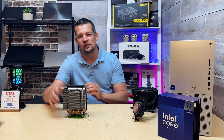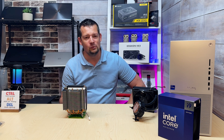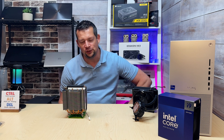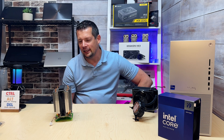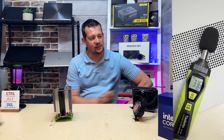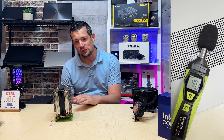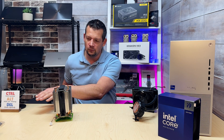When the tower cooler is installed and idling, I can hear a little bit of fan noise, but it's almost like a very subtle, very quiet rattling noise — which is a concern. I cannot tell if this is the unit or the case, and I can't buy multiple of these to rule it out. Also, I don't see the Dell stamping on it, which I'd love to see for 80 bucks — it's going to be a return. With the sound meter at the top of the case, idling is very subtle and quiet at 34-35 decibels. When you start pushing it, it only goes up to about 45 decibels before throttling kicks in — about half the sound of the little pancake cooler.